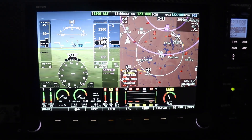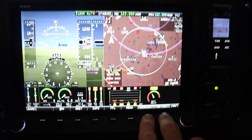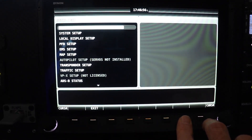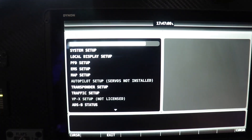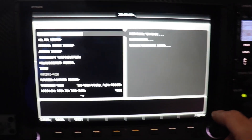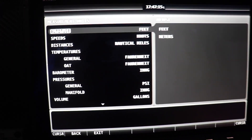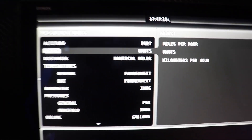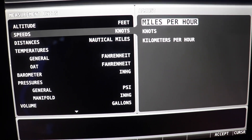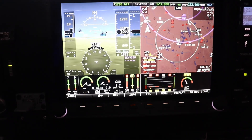I'm going to switch this over to miles an hour, then we'll go up and fly and see what performance numbers we get. I'm going to show you how easy this is to do on the Dynon — I'll hold the camera in one hand and work the buttons with the other. If you hold these two buttons in for a second, that gets you into the setup menu, and you can use the scroll knob to scroll through the menus. Go down to system setup and press the button. Another menu comes up — go to measurement units and hit the button again. That takes you to speeds, and you can see it's in knots right now. Click the button again, scroll up to miles an hour, click to finish, and hit exit. That's it — now it's in miles an hour.